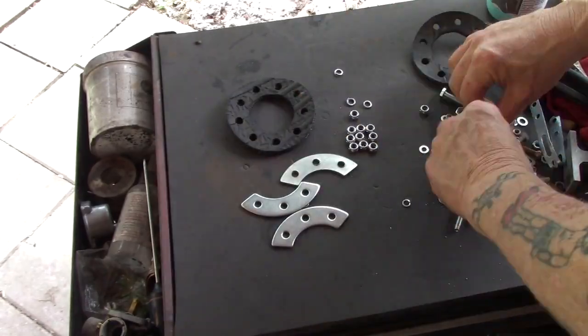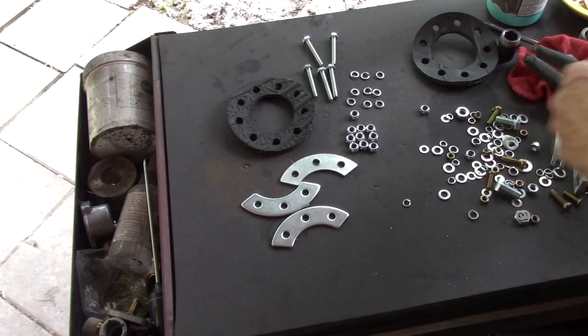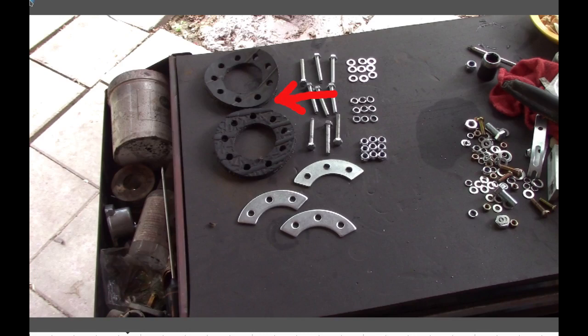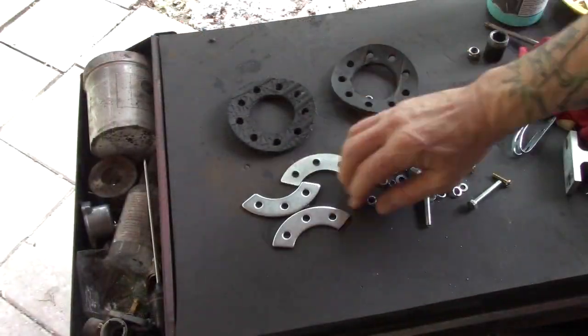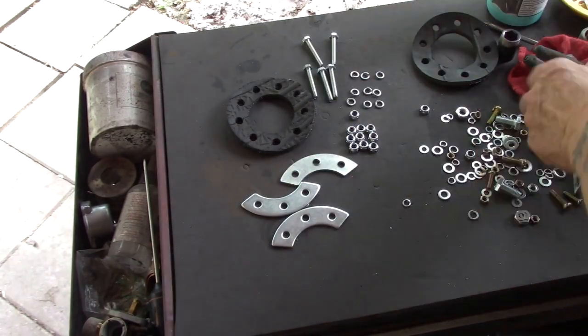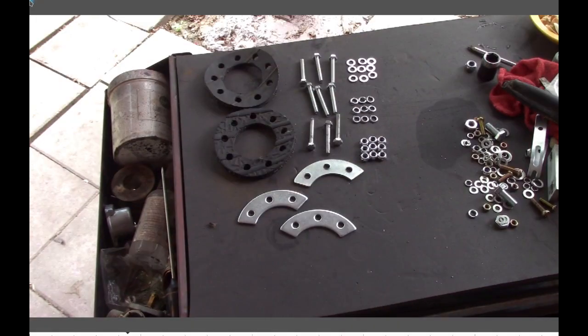I'm going to show you how to do it - it's not that hard. So you've got a bag with your rag joint goodies: two rubber pieces - set them aside; backing plates - some kits have three, some have two; nine holes drilled in the sprocket, your plates will have nine holes altogether. You need to sort through your hardware - there's some extra hardware sometimes - and you need nine 6mm mounting bolts, nine flat washers, nine lock washers.